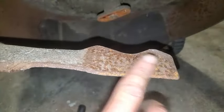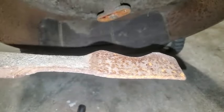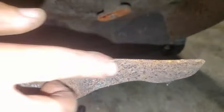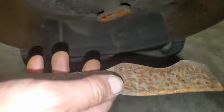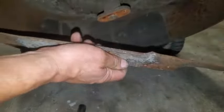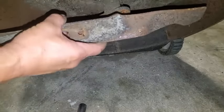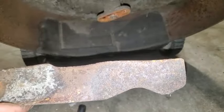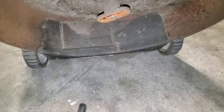And you don't want to sharpen on the underside. Here is the angle. And you want to maintain a 30 degree is optimum. And then all I do is I take the little burrs off the back, but I do not sharpen the underside. You don't sharpen the underside. So the sharpened edge goes up. When you reinstall it, the sharp edge, up. So when you're looking at it from the bottom, you shouldn't see any kind of angle bevel because it should be on top. I'm going to go ahead and sharpen this. Be right back.